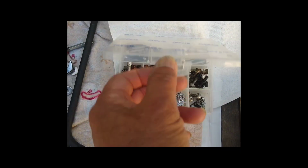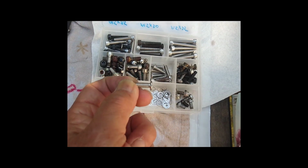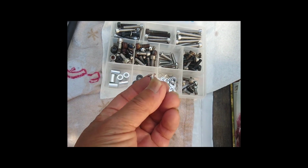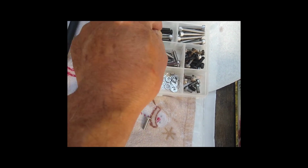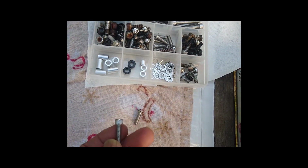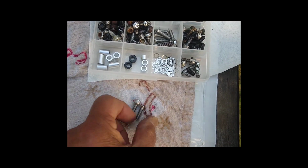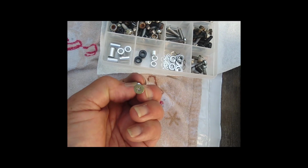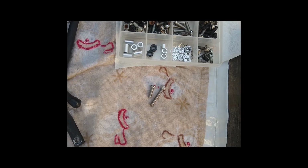Okay, looking at my 5mm screw collection, it's this screw here that is a thin head, and this will clear your chain so it won't hang up. Because if you use a regular cap screw, let's just grab one of these, this head is thick enough so it'll interfere with the chain. It'll get hung up when you go into the outermost chain. So the connection here is with a Phillips screwdriver. Okay, I learned that from Yost Brand.